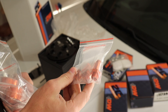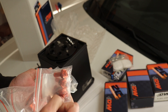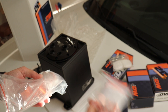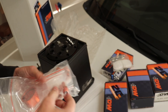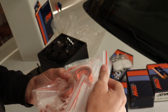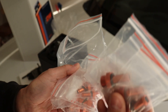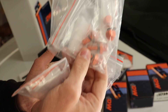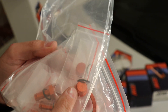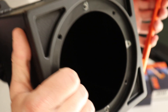Really, if you wanted to, you could run one external pump, two or three. I might not even need the third, but we'll run it anyway. I initially was just going to buy two pumps, but it was only $30 more to get the package. So we've got all the fuel pump we need. The 300 and 200 pumps do require these adapters — we've got two different size fittings. This is for the 400 pumps, these are for the 300 and 200. And then we've got a couple little block-off plugs in case you only want to run one pump.